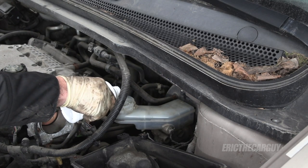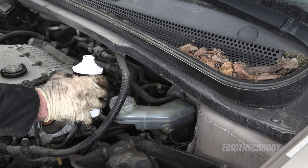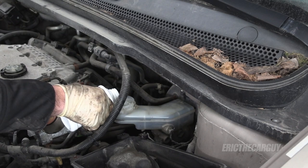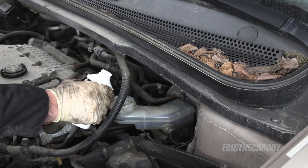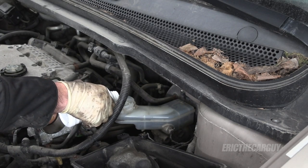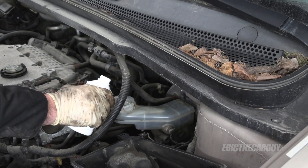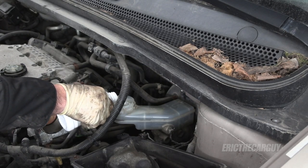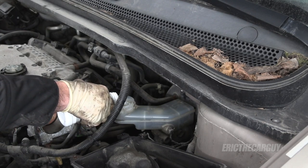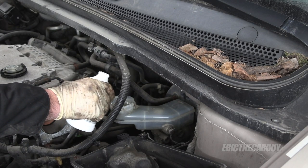Because there's new friction material both front and rear, I can fill it all the way up to the top. Brake fluid gets low for one of two reasons: the brake pads wear and extra fluid goes to take up the space as the piston extends further out, or there's a leak. Try not to overfill it, because some people compress calipers during brake jobs and run brake fluid back into the master cylinder — if you've topped it off before that, brake fluid could go running out everywhere. I only top it off after a four-wheel brake job. It took about two bottles of brake fluid to get here.